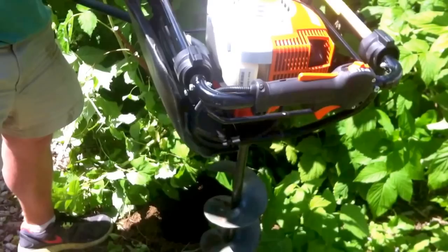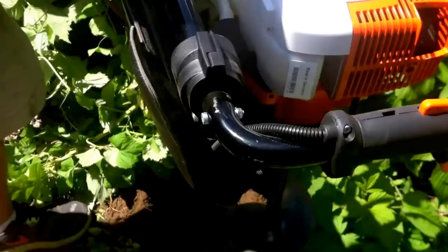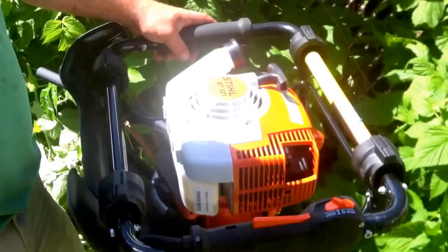These two-strokes are highly efficient for what they do on fuel, so you'll be happy on that as well. But make sure you use your ready mix. We always use Stihl's now because anything with ethanol in it just plugs the heck out of small carburetor engines. It may be good for the environment, but there's a lot of argument about whether corn ethanol is a good idea or not. It doesn't matter, it's in most gasoline now, so go find yourself ethanol-free fuel, or buy yourself a 16-ounce can of pre-mixed fuel with stabilizer as well, so if you leave the machine around for a while, your carburetor won't plug up on you.